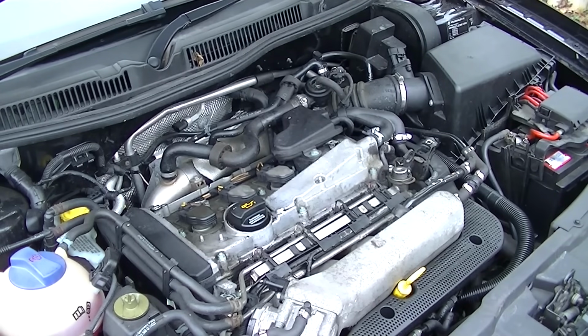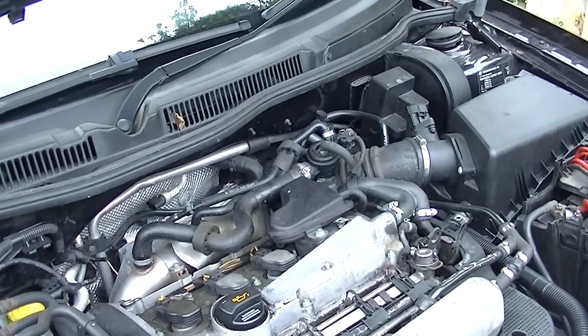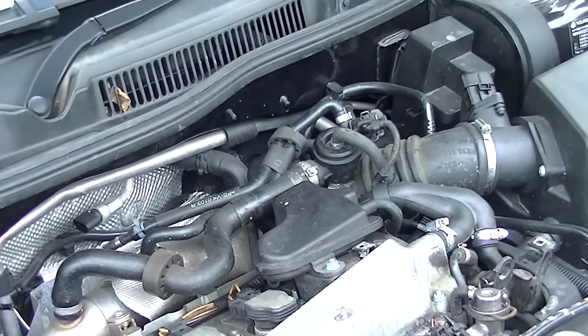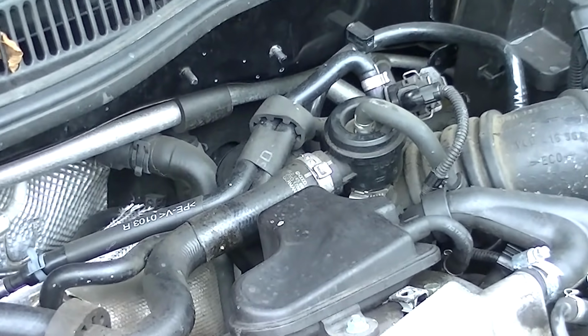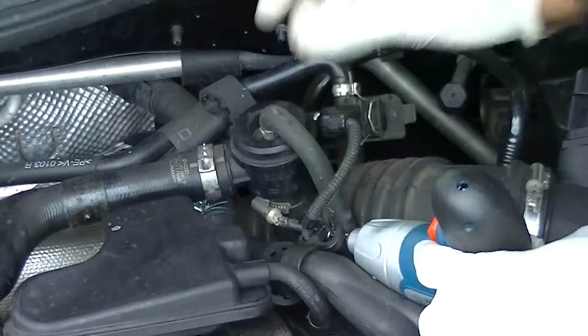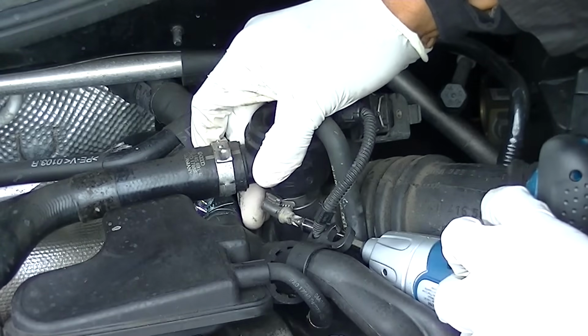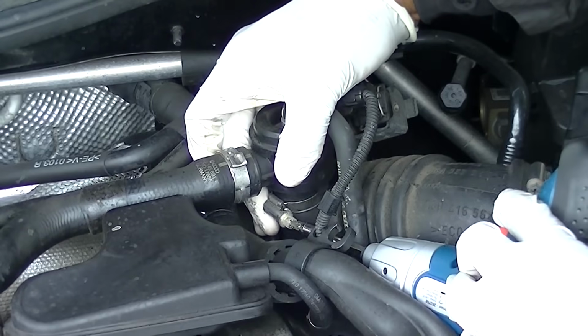Now just in the top middle part of it is the diverter valve itself. There you go, a little zoom in. It's just behind the air mass sensor in this little jump. Looks like a mushroom shaped sort of thing, but this is the recirculation valve. This recirculates all the extra boost back into the air intake again. So now just a matter of releasing the bottom part of it. There you go, really easy.